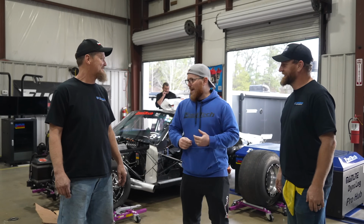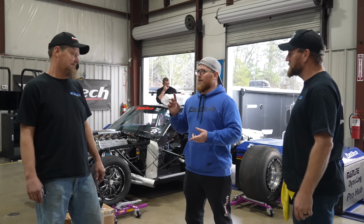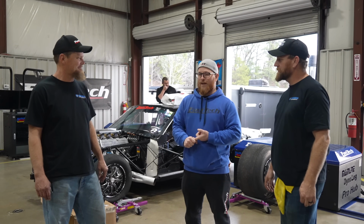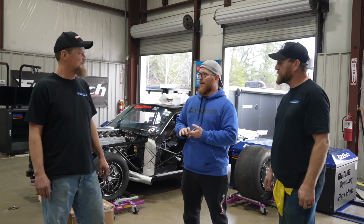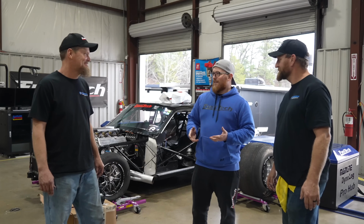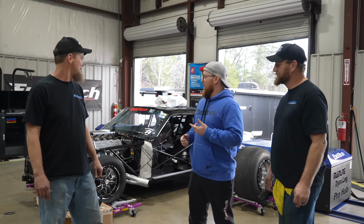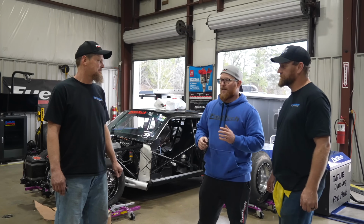Right? And we made some pretty good power on the dyno today, but it was really eventful, right? So we got it on the dyno. First thing, we did a pull and lost a bunch of fuel pressure because the fuel pump wasn't big enough. So then we played the game of making new fuel lines and grinding on stuff to make a fuel pump fit. Par for the course. So this is a whole day full of custom, right? And we ended up making, what was it, 1669? 1669 horsepower. Converter is loose.